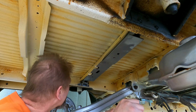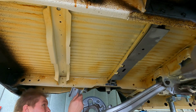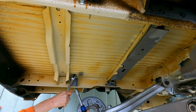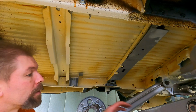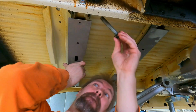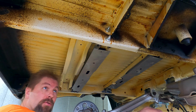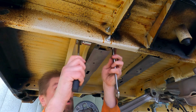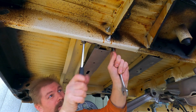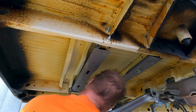The first one is here, first beam. I need to check those bolts which way the heads go. This kind of bracket, I don't know which way. It should go this way. Put them at 75 Newton meters. And then this beam, and it should be in this way. Yeah. And these bolts I'm going to push to 160 Newton meters. These are self-locking nuts, so these are not going to open. I'm tightening them to the same torque as the front axle. Same bushings and same bolts, same style. This is quite tight.